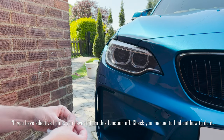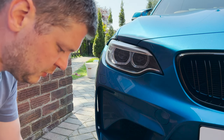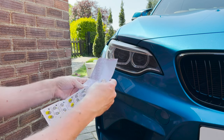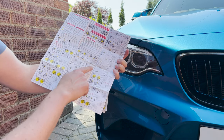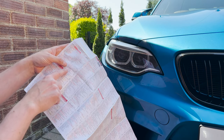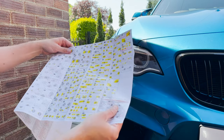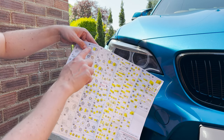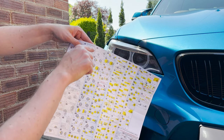I've got one of these kits from eBay. They aren't very expensive, so I really recommend you get one if your car isn't equipped with LED lights. It comes with quite a handy manual as well. It has a list of cars which is quite extensive. You find your car on the list and then you pick the photo with the same number. For BMW 2 series, there are four different options. I've got projector plus xenon headlights, and that's number 1-1-4. So now I'm looking for 1-1-4. We have to cover only about a quarter of the lens when looking at it from the front of the car, and it needs to be level with the lens.